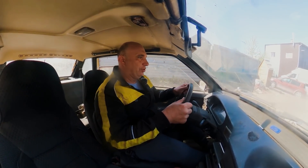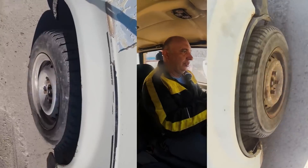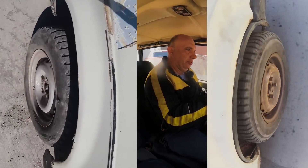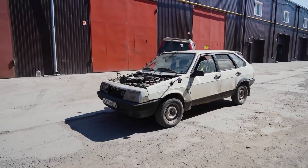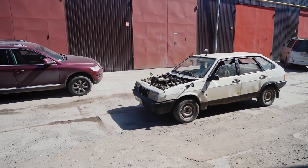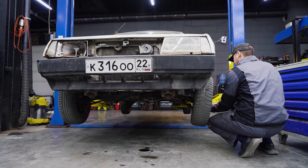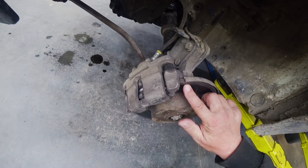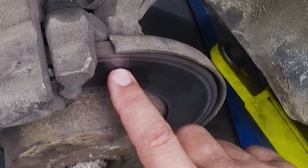You are not supposed to hear these sorts of sounds on a car with stock brakes — if you do, it means the pads are completely worn. These work nicely when you apply full force. These brakes bite pretty hard — the car stops on a dime. They seem to be holding up. After that rather short drive, you see that look? It's as if the rotor has been resurfaced — it's nice and smooth. You can really see how the porcelain tile pads we made were biting into the metal. We can see some well-defined grooves.